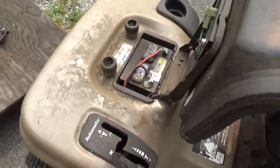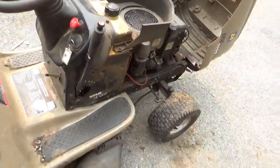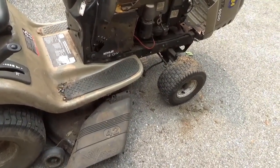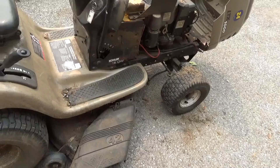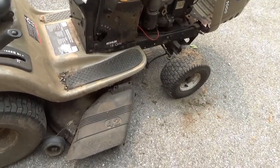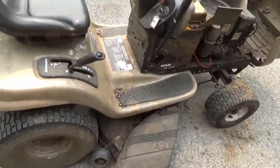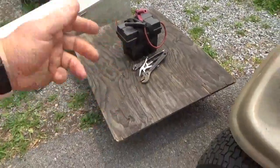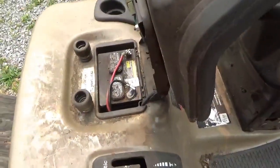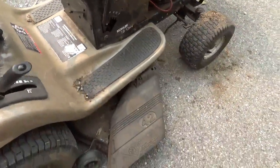It did come with a battery — this is a 2005 DieHard. I put a charge on it and if I test it, it's coming up at about 125 cold cranking amps; it should be about 350 cold cranking amps. So it's kind of dead. I brought out the jump pack and a few tools, and you can see I put new terminals on the battery already.